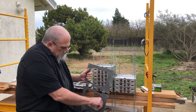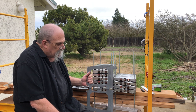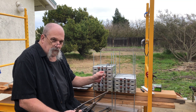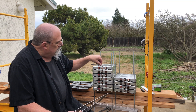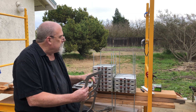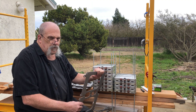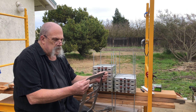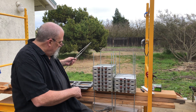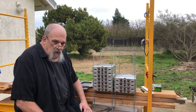We're using the short stack mount that was used in the Nissan LEAF. We've got end plates and metal spacers that go in between each cell. We're using all-thread — you run it through and tighten it good and snug. It won't over-compress the batteries and it will hold them securely. That's what I'm working on today, to see how well that works.